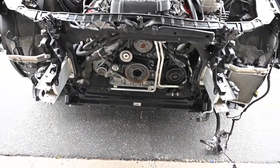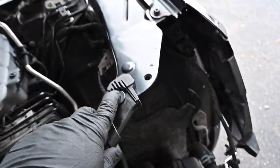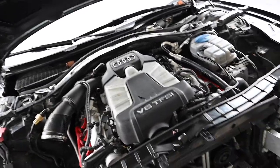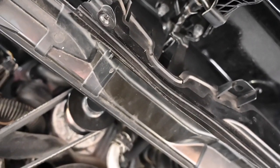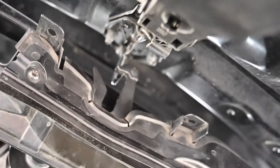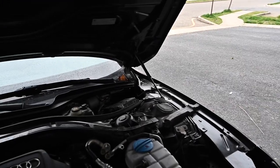We've got the radiator support mounted to the body and torqued up all the bolts — three bolts on each side plus up top. But the problem I'm having is that the hood is not actually closing. I was hoping the alignment would still be good, but clearly it's not. It's off by about maybe half a centimeter, so I need to adjust some of the brackets. I thought I handled this already, but without the actual hood hinges or latches I couldn't be sure, so I'm going to try some adjustments.